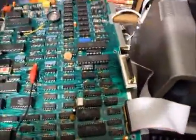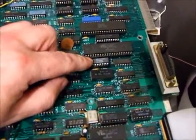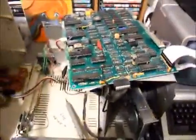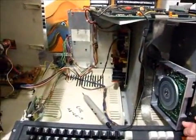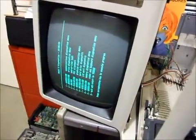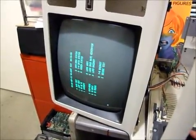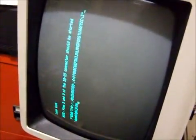We are back. I've replaced the MC1488 chip — it's in a socket now. The replacement one I bought from Jaycar. So let's test our handiwork. Machine on, let it boot up, go to com menu, RS-232, and now when we press auto test we see that the serial port is working again.